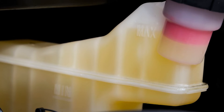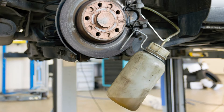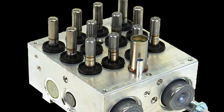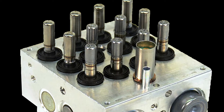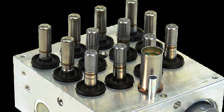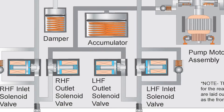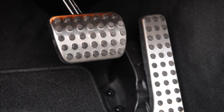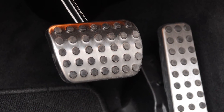If the vehicle has not had the brake fluid changed as per the service schedule, this can allow corrosion and sediments to jam the solenoid valves and cause them to leak. Depending on which solenoid is impacted, when the brake pedal is depressed, it can allow brake fluid to compress the accumulator, which will give a soft or sinking brake pedal feel for the driver.